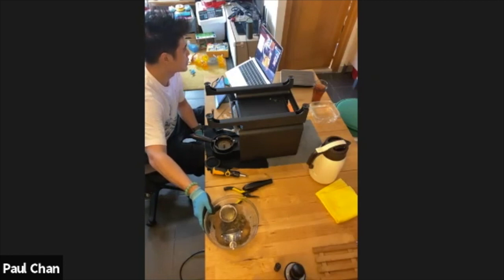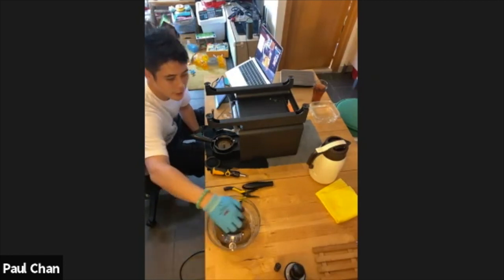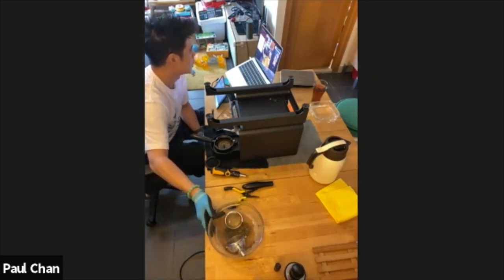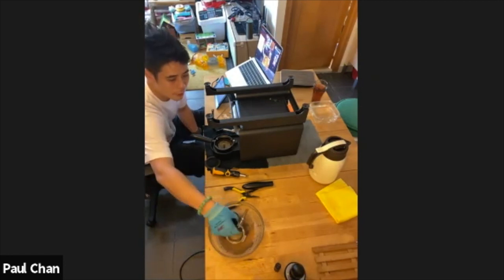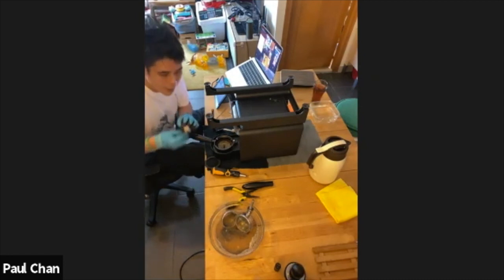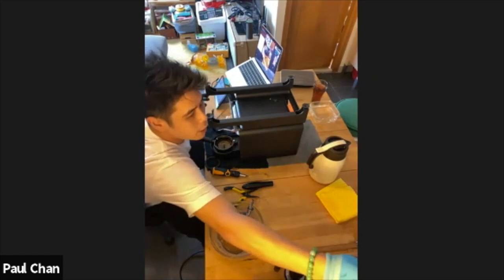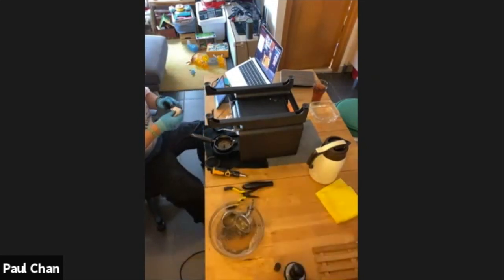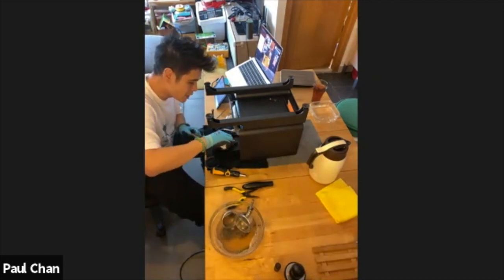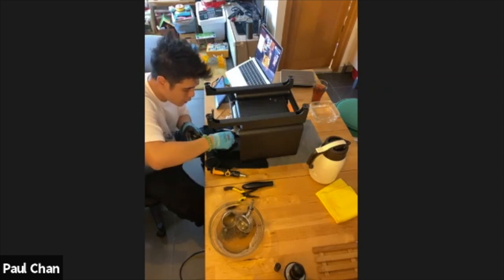You can kind of see already it's going brown, and this brass plate here is getting a lot cleaner as we speak, and a little moving around doesn't do it any harm. Okay, so while that is soaking, you can use the solution in here with a brush, or in my case a tissue or paper towel, and you can go into the seams here and start cleaning and rubbing away that coffee grime while it is soaking.